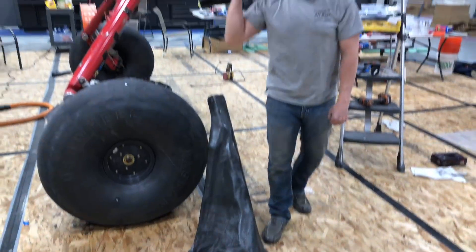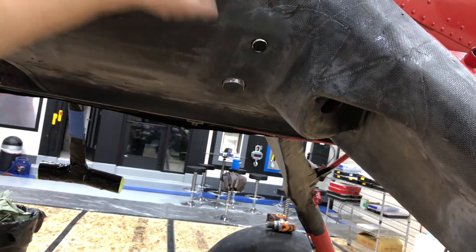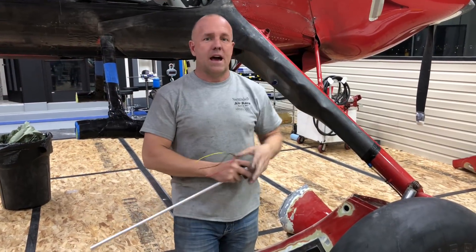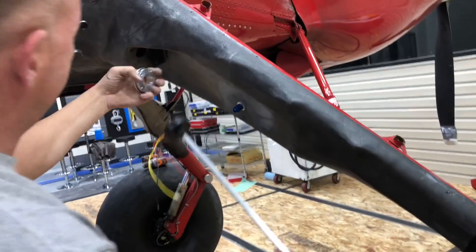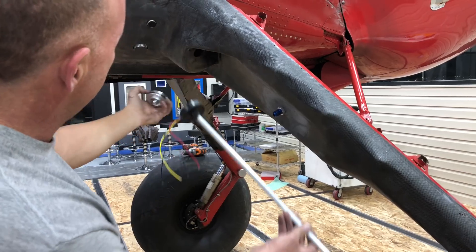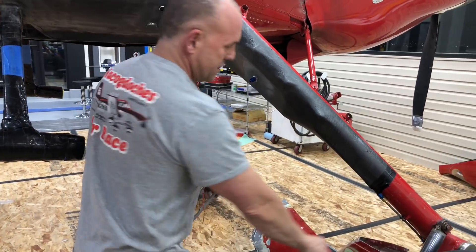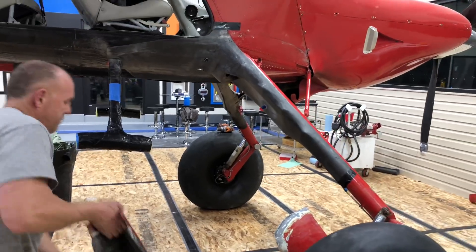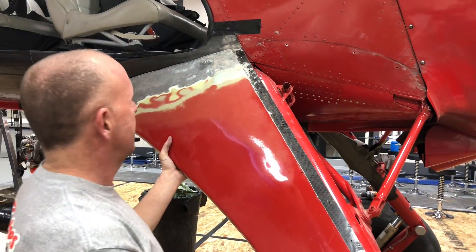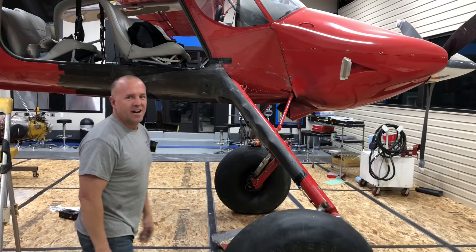It's light, it's perfect, and it's done. This is the other two sides of the tank fitting. This will air vent back up to above the wing. This is the fuel line that will come in and feed the fuel tank once the wing runs out. There'll be a fuel probe in the gear leg. I've machined this adapter - I've machined a whole bunch of adapters - this will fit inside that hole right there. This probe will come in and sit here, then I've got a fuel probe that goes in my gear leg right down to the bottom of this funnel, so there'll be no way for me to port fuel. This will actually be bonded back up, and I'll be able to get pretty radical on anything I need. Wherever my fuel's at, I'll be in good shape. Halfway done - let's get to work.